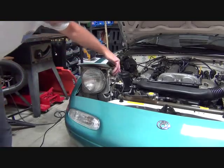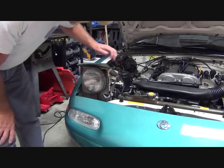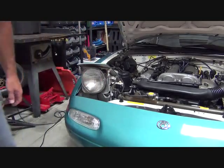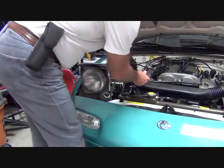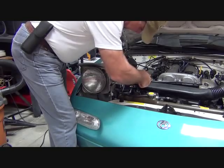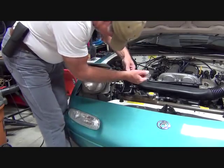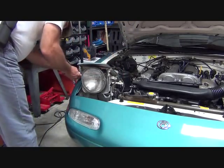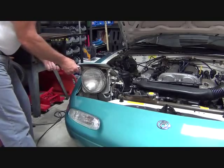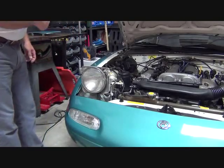Next, we're going to remove the body cover here. These are quite tight, so I don't use a Phillips on these — you can use either a Phillips or, I want to say, an eight millimeter. We'll remove the four screws. We're not going to reuse them, so you don't need to take them all the way off. These are slotted to allow for adjusting. I'll loosen them up — it is eight millimeter. I'm going to remove that piece; we'll be reusing one part, but not the other.